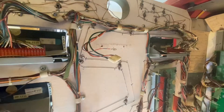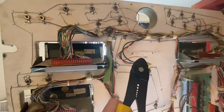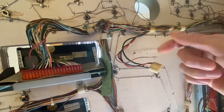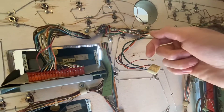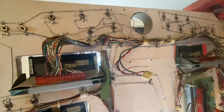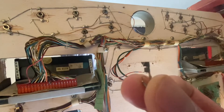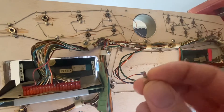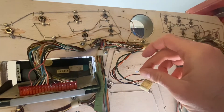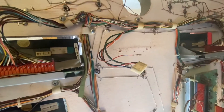One other thing to watch out for: you want to use some sort of crimping device to crimp these in. Instead of trying to pry the old metal connectors off and reuse the same piece of wire, just cut it as close as you can, restrip it a little bit, and crimp on the new one. These come with little wings on the back side — you want the smaller wing to be touching the bare metal and the larger back wing to be on the rubber part of the wire. That's how it holds on. If you crimp that down pretty good, they should last many, many times.